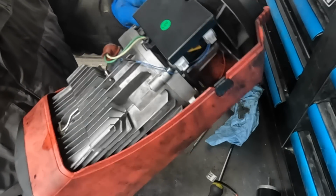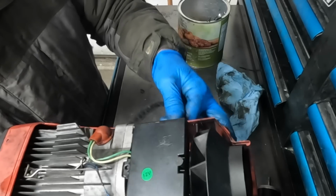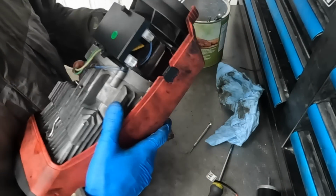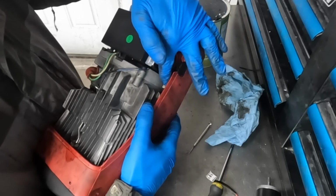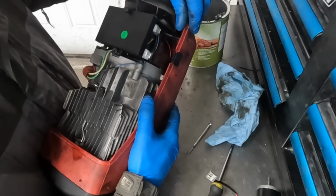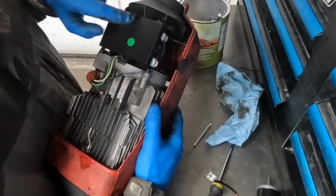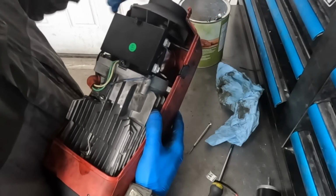Once you get the body of the heater wiggled back into the case, you want to make sure that you get your grommet put in place. This grommet goes into the case here. And you also want to make sure that your little supports are in the right place in the case. There's an aluminum one on each side of the fan housing there, and then there are little ones on the outside of the fan here and here. One on the top here and one on the bottom, but as long as you have these two lined up, the other ones will be lined up as well.